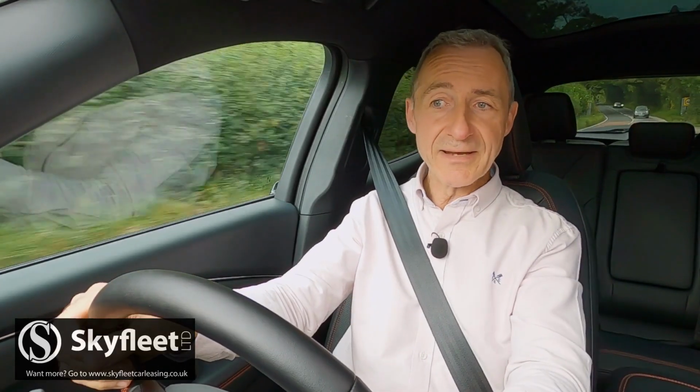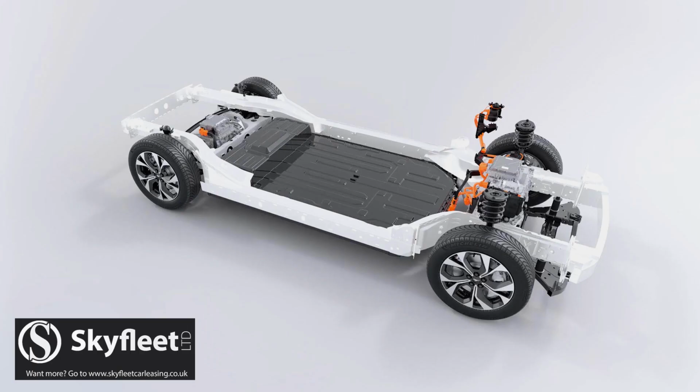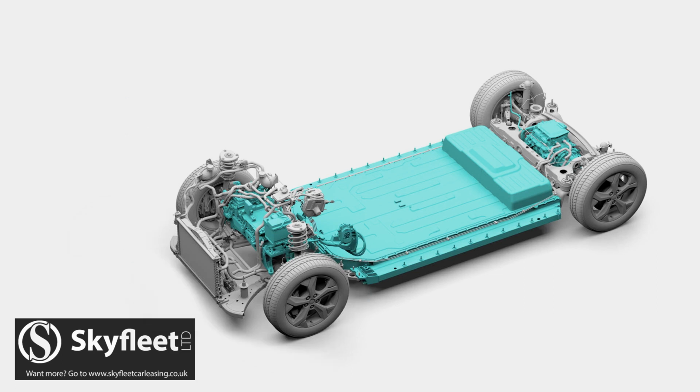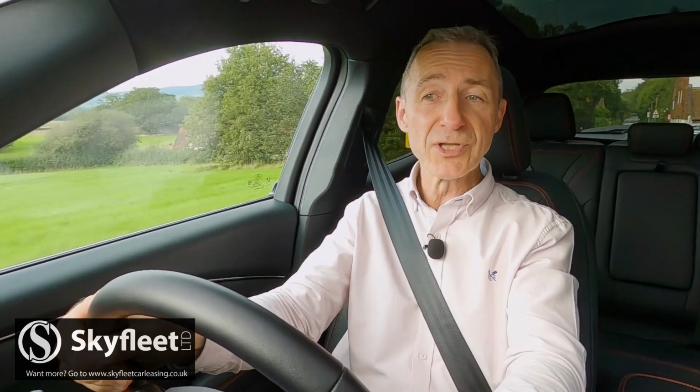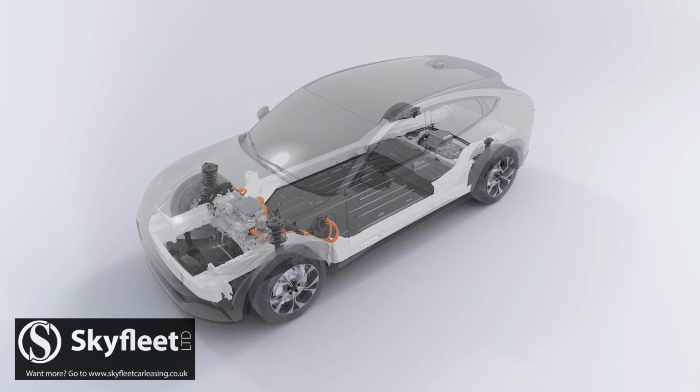The Mach-E can be had in either rear-driven or all-wheel driven forms. The latter version adds to the rear axle AC electric motor a further electric motor at the front. Either way, with a base 68 kWh standard range battery, this Ford puts out 269 PS. The bigger 88 kWh extended range battery we have here is a weightier thing, of course, so Ford increases the power output to match, to 294 PS with the rear-driven model and to 351 PS with this all-wheel drive variant.